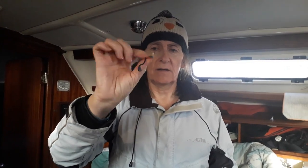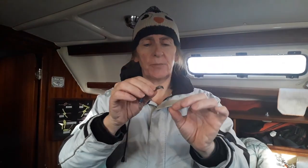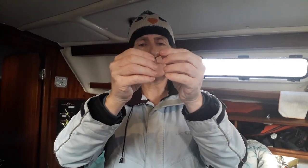This is the rather ratty piece of cable we've taken off - you can see it's hanging on by a thread. It's a bit of a jerry rig - I thought it had a flat spade connector but it's actually a piggyback. The other end is literally hanging on by a few strands of copper. That was on the D+ terminal on the back of the alternator. It's now been replaced, we've started the engine and tested that the alternator is charging - we can see the charge on the panel. So this piece of junk can go in the bin.